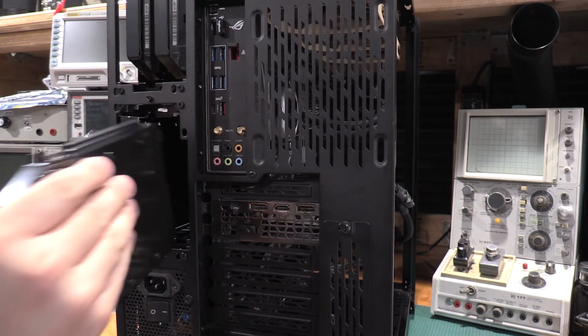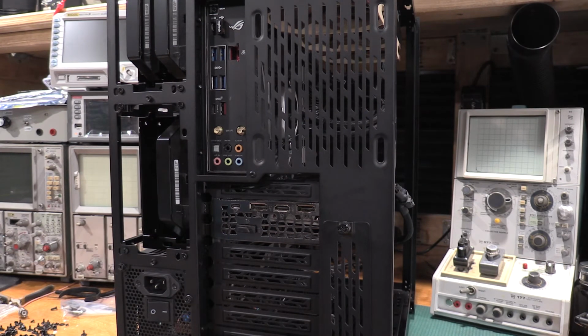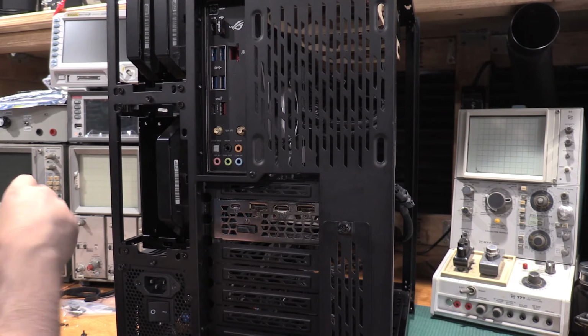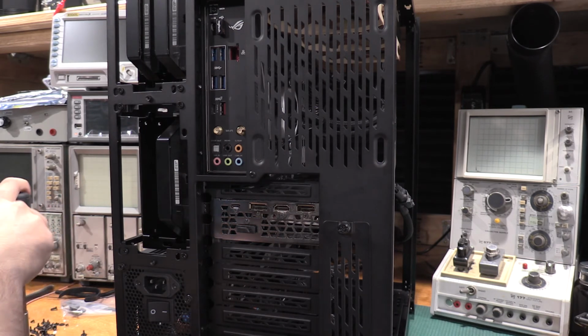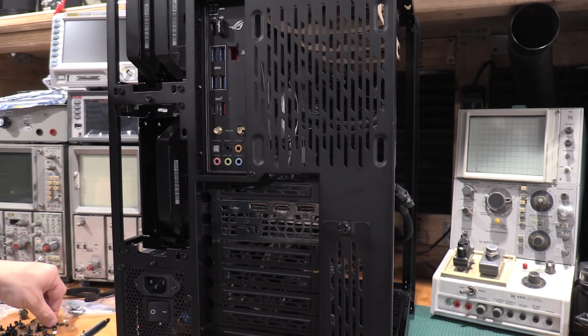My primary bulk file storage is RAID 6 as opposed to RAID 5. The reason it's RAID 6 is because it's 26 hard drives, so the odds of a single drive failure are higher than average when you have that many hard drives in a RAID set. I don't need that to be super fast storage because it's not loading games. It's just there for bulk file storage for my videos and things like that. So I don't need it to be completely blazing fast. I don't want it to be pokey either, but it doesn't need to be crazy fast.